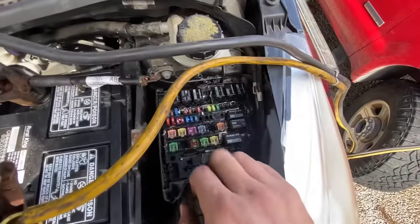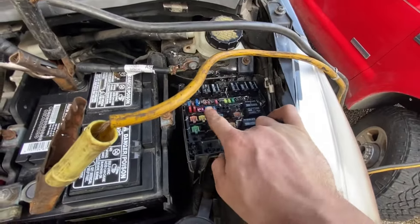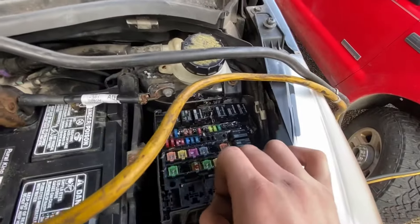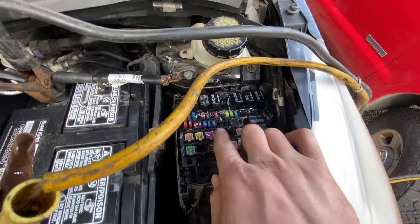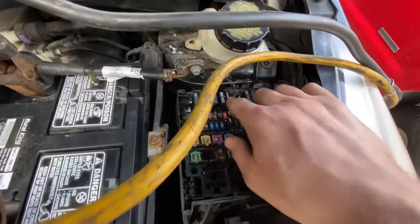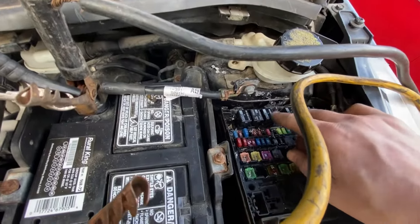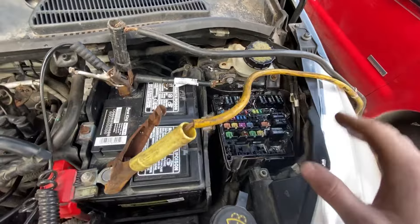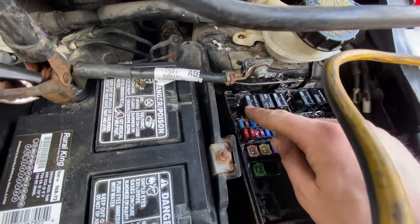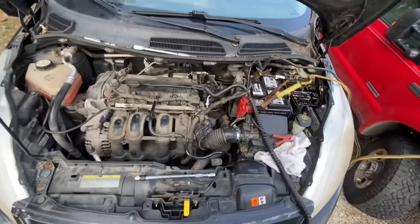The shop said that a lot of these relays and fuses were corroded really bad, and what they did is they cleaned up the fuses but put an absurd amount of dielectric grease on all of these connections. That was causing all kinds of problems. You don't want to completely cake it on there because then you're not going to get any connection at all — just a light coating. Looks like what they did is they pulled these and just caked it in there. Don't do that.